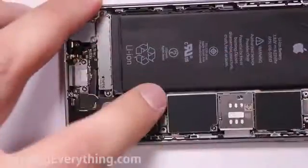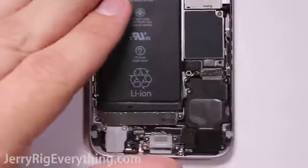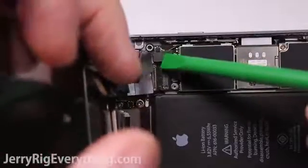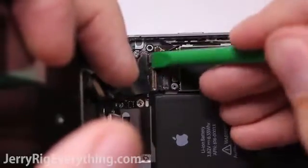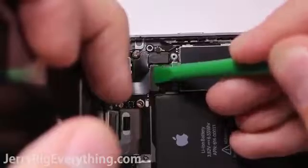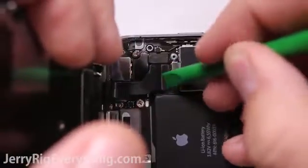Take the battery, plug it back into place, take the 2 screws, screw them into the metal plate over the connection. Then you can take the screen and plug in the connectors. You have one for the front-facing camera, you have the LCD, and you have the digitizer. Once they're all plugged into place, they're like little Legos. You can just kind of plug them in.